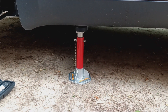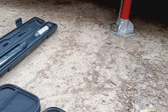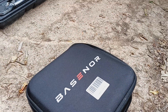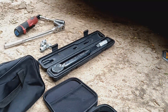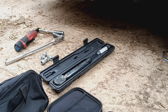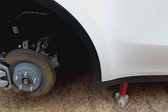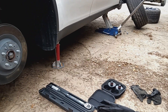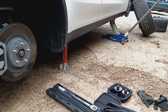I'm going to swap the wheels — put the good wheel on the front and the brand new tire on the back — and leave the vehicle on site on the jack stand. These pads come in a set of four; here's the brand I use. There are several competing brands and they're probably all pretty good. I've got my torque wrench ready to go — the spec on the Model Y is 129 foot-pounds. That's pretty much all you need to know to get this done. Thanks for watching and good luck.